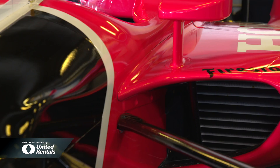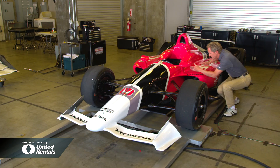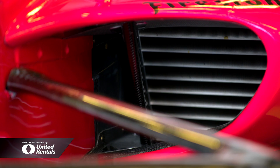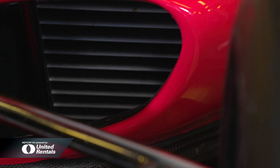From a safety standpoint, there's a huge improvement here in side impact and this crushable structure. The radiator has been repositioned and now has bulkheads built into it, making a completely crushable structure protecting the driver 8 to 10 inches wider than it was before.